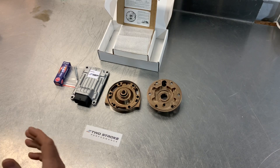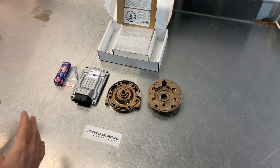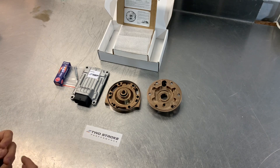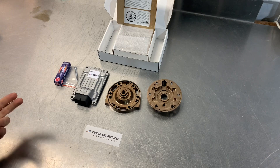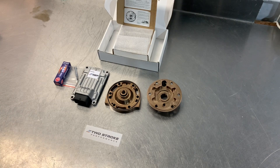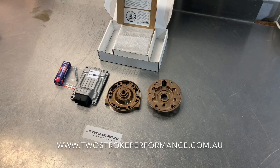Aside from initially setting the air screw, there's not really any tuning required. You get the air screw set depending on your individual bike and then you just ride it — you don't need to think about tweaking ignition curves or fuel curves or anything like that. We've sold hundreds of these kits, and in almost all cases you can account for individual bike variation with some small changes to the air screw and the idle speed. Once they're set right, assuming no other mechanical faults, the bikes just ride really nicely. It's simple to install — plug in the ECU, screw in the spark plug, maybe fit the idle bolt and spring, bolt on the head — in less than an hour you're ready to go. Check out the website for more info, there are dyno curves and a write-up on compression ratios. Flick us an email if you have any questions. Thanks for watching.